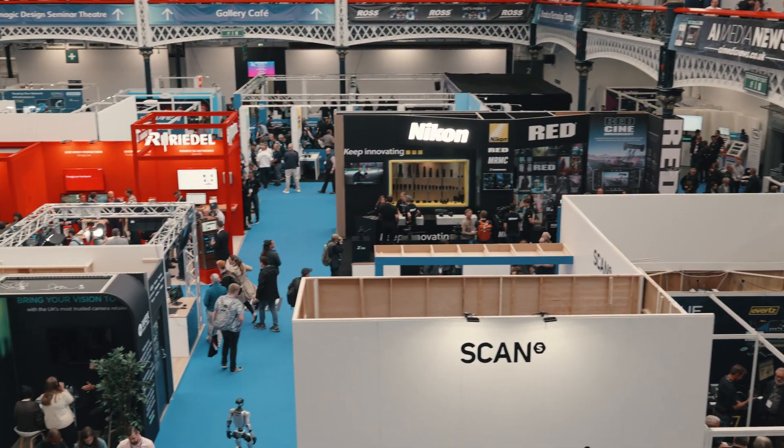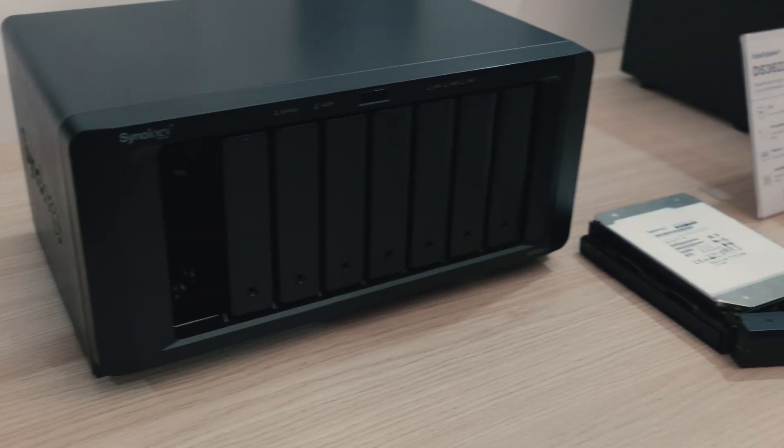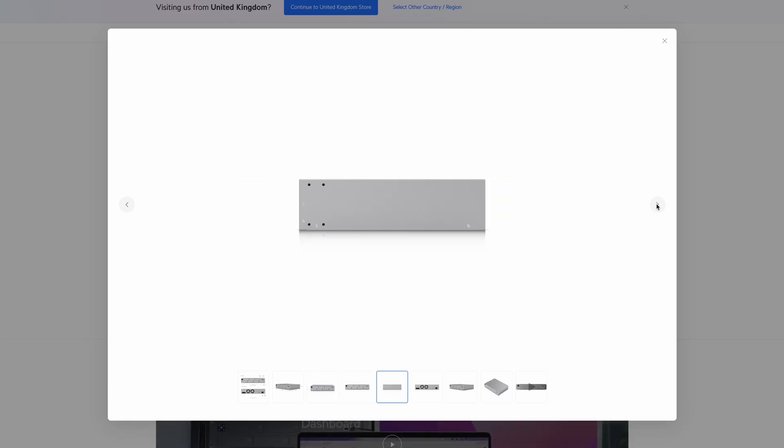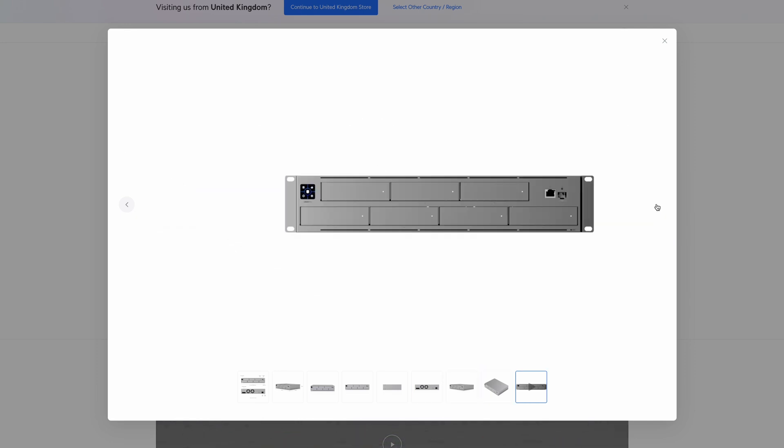So why did I choose a Synology NAS? After diving down rabbit holes, Reddit threads, YouTube videos, and even talking to vendors at the MPTS trade show in London, I chose the Synology DS1821+. Why not Ugreen, Ubiquiti, or QNAP? Well, Ubiquiti's NAS is gorgeous but underpowered — no SSD cache, limited RAM, and the software is super basic. Ugreen is promising with modern specs and built-in 10G, but the software is still immature and I don't have time for command line workarounds. QNAP builds were just coming in over budget. So at the end of the day, it was Synology's software that convinced me.